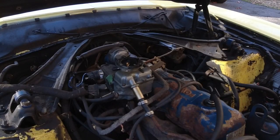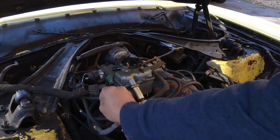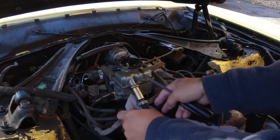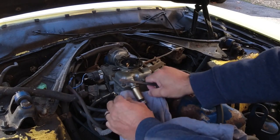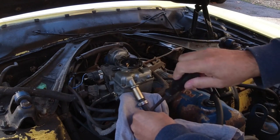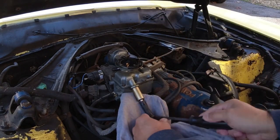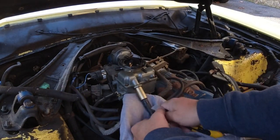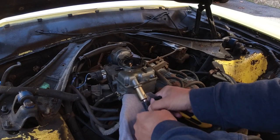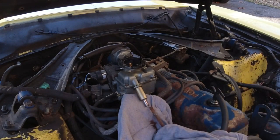Let's get this old carburetor off. I'll start with the vacuum lines — getting that clamp off. That's not supposed to just pop out. I'll keep gas off the exhaust manifold; since this is a straight six, the intake manifold is right above the exhaust manifold. Let's see how much gas we get out of this — yep, empty. Rusty too. This whole thing is rusty. I'll get rid of that using the one-size-fits-all wrench.